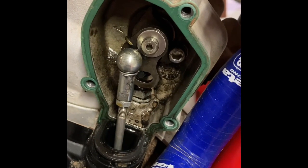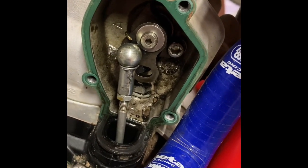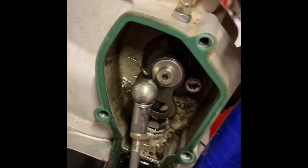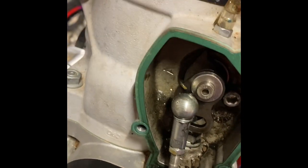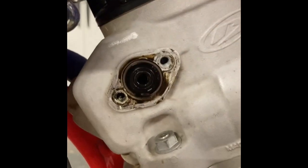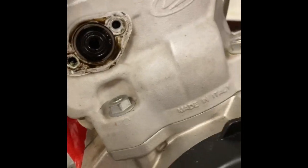Okay, I pulled these covers off and I got lucky in all 3 cases. The gaskets were fine. Notice that this gasket stays on because it's pinched back behind this rubber piece here. I pulled the flange off the front of the cylinder here. The reason I'm doing that is I'm going to pull my flapper for the exhaust valve out through that hole when I'm done. And over here on the other side of the bike, this one came off and the gasket stayed with the cover, so I'm all good there.